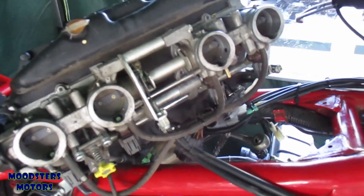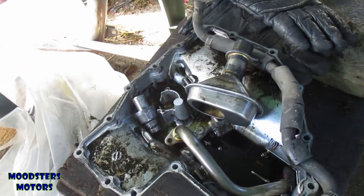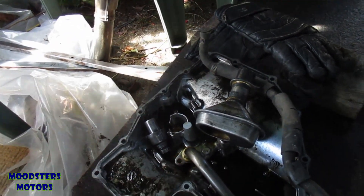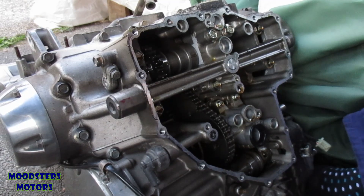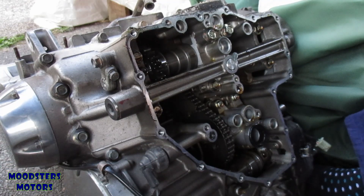I've also got to be careful about the routing of all the wires. I'm going to start putting things back together by handling the scavenger pipes and scavenger onto the underside of the sump, then put the sump pan back on. I'll do this with the removed engine as it allows a better view than trying to get a camera underneath the bike. This is the replacement of the sump, oil pipes, and oil scavenger removed to get the clearance to extract the engine.